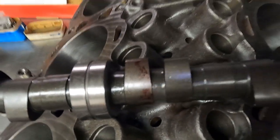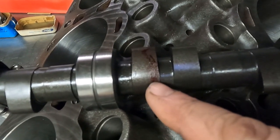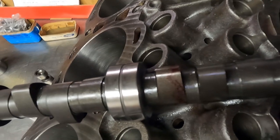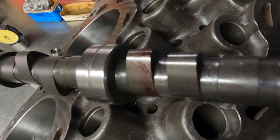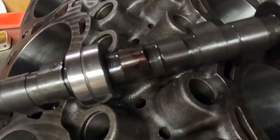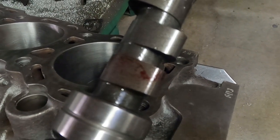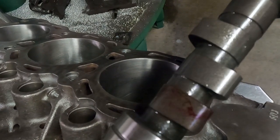This is what we saw. This is a Ford, so it has standard and reverse taper. This particular lobe is riding on the right side. You'll be able to see the lift pattern — the red dye — run up the side of the lobe. And then up at the top you're going to see that M shape: where it goes away from the side of the lobe, rolls into the center of the lobe a little bit, and then tracks back down the side again. You can kind of see that M shape occur.